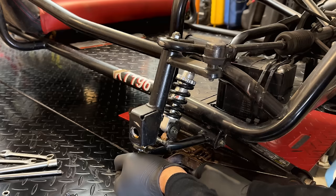And then lastly, the final wire is actually going to be the engine kill. So when you flip the switch to off, it'll pick up ground from right here. It'll send it through the switch, down this wire, and ultimately to the engine. So this is more or less ready to be done, or finalized, I should say, by installing the switches here on the control panel.